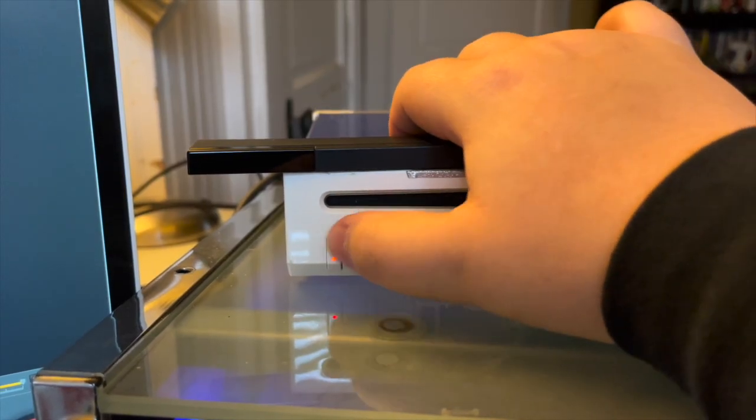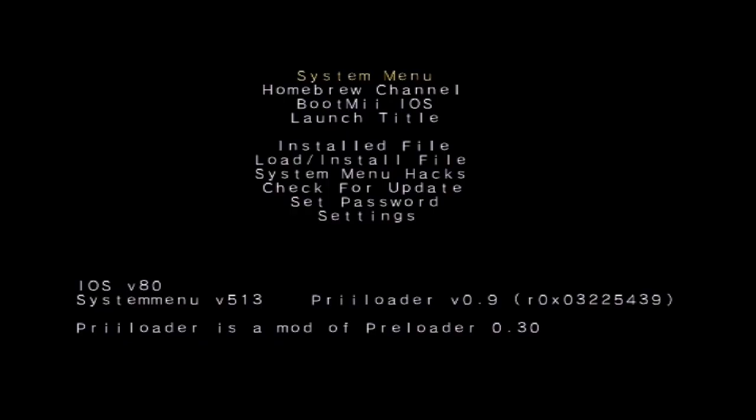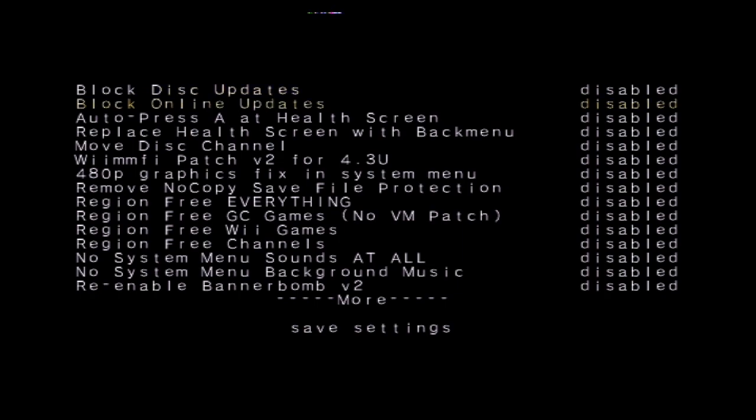To launch Priiloader, power on your Wii, then immediately hold the reset button. Should you brick your Wii, this menu will appear and allow you to launch into bootMii iOS to restore the backup that you made. There's also some useful features under the System Menu Hacks option. You can use the D-pad to navigate through this menu. Inside the System Menu Hacks option, you have options such as disable region locking and moving the disk channel. If you don't know what all these options do, there will also be a link in the description that will describe all of these options.